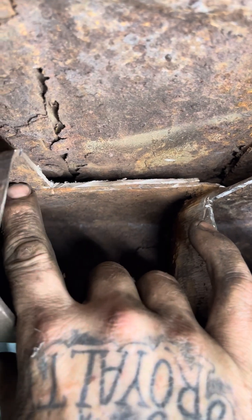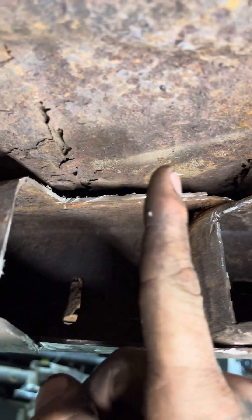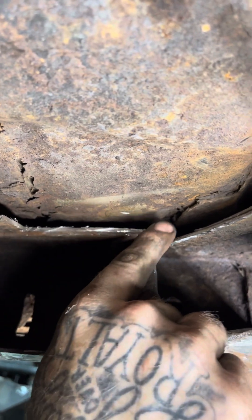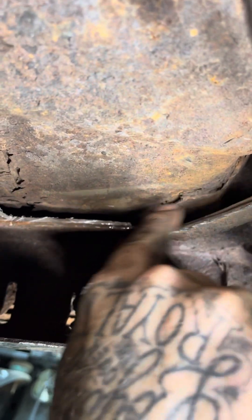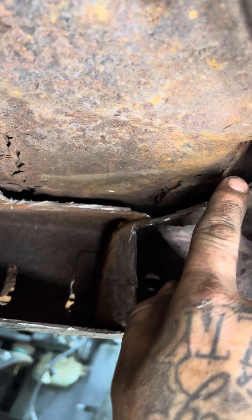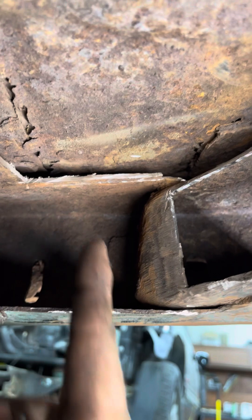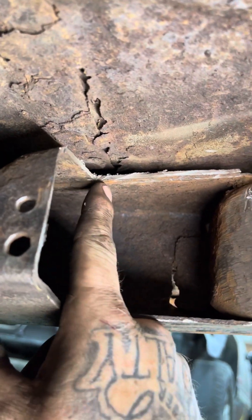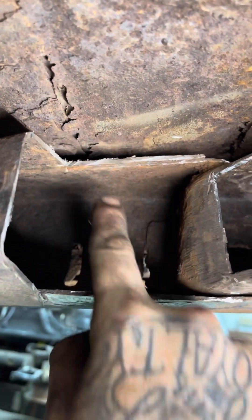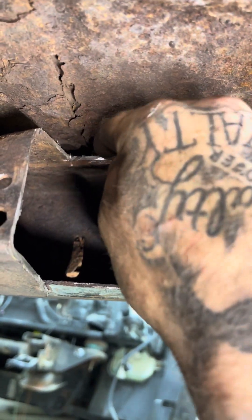My next patch is going to come from the corner right here and come all the way across, filling that whole section in - like the piece I cut out that was up there. It tied in right here; you can see there's still a little bit of weld left, I gotta grind that a little more. Basically it's going to come straight across into there and tie into this piece. By me opening this whole part of the frame up, when I put that patch in there I'll be able to weld this seam here all the way down, then come on the inside and weld this whole seam all the way across from the bottom, so it's going to be completely welded - just welding on the inside instead of the outside.